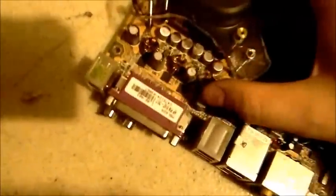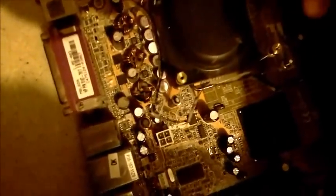What I did was I drilled four holes in the block down through the solid plastic, ran a screw through each one, put a nut on the bottom of the block and on the top. This is a piece of plexi cut out to go over the block and extend out to the holes where the motherboard has for mounts. So basically you take a screw, put it through the block, through the plexiglass, tighten it down to hold the plexiglass to the block, and then you drill four more holes to match up with your motherboard mounting holes.